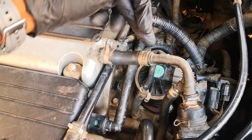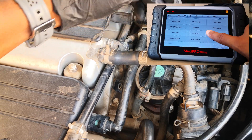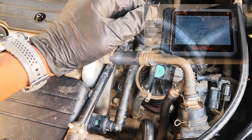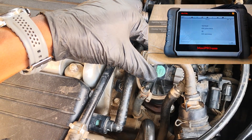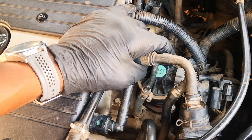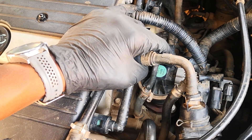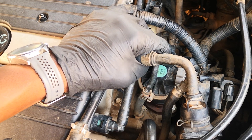If you follow this channel you will notice on my last video I had done an active test on the EGR valve and it performed suboptimally. The opening times and the closing times were elevated even though I don't have a check engine light. So this is about trying to sort out this issue and I'm going to be repeating the active test using the Autel MP808TS in the end to see whether this goes away.